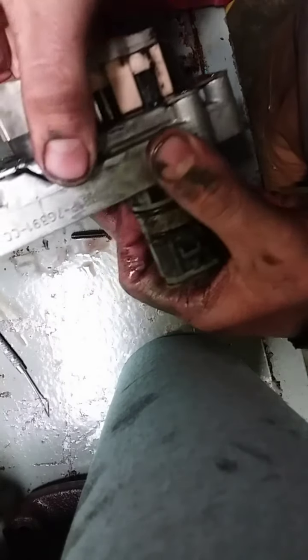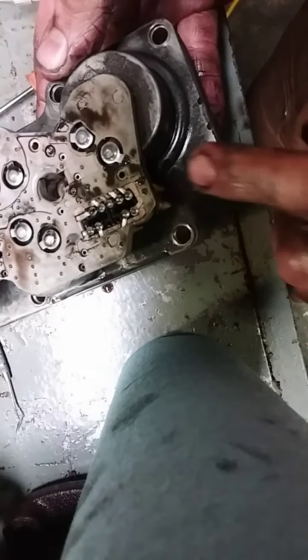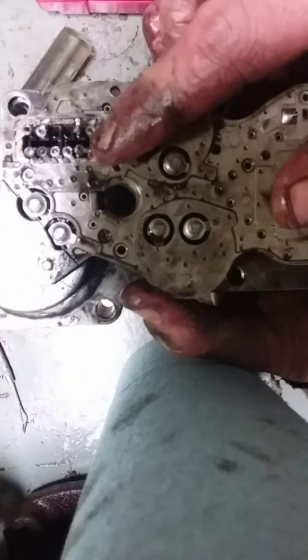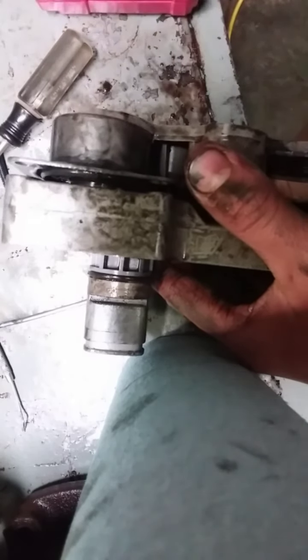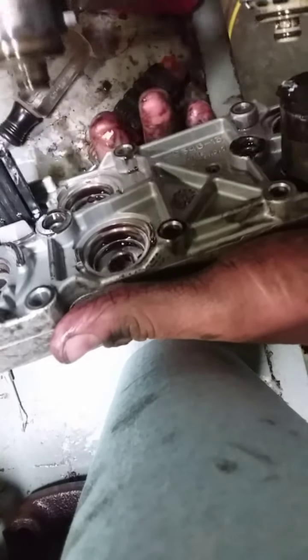We still have this solder on this end holding us down, but I don't know, maybe we get lucky and be able to wiggle that out, but no, there's no chance. I'll have to desolder this, pull that whole board just like the other one, and get that out of there. Okay, got all the solder melted out. Sometimes to get this to lift out, you got to get a screwdriver in here and leverage this one. This one was much more stuck than the last one, but once you get it, it just lifts right on out like that. And then the one solenoid we want is just sitting there.